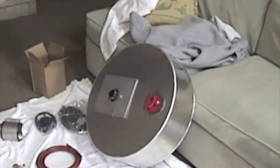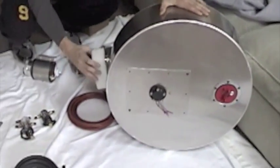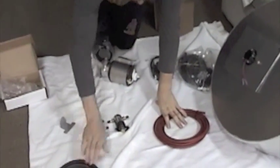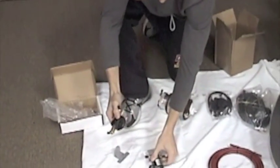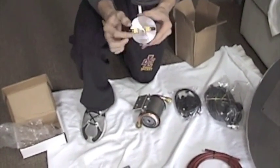What we got there is the big aluminum canister — that's the tank that's going to mount in the rear of the car. We've got some tubing that's going to route the grease up toward the front. We're going to route through two valves: one valve to direct grease into the engine, the other valve to direct the regular fuel, the diesel. It routes in and out through two ports on the top of the can.